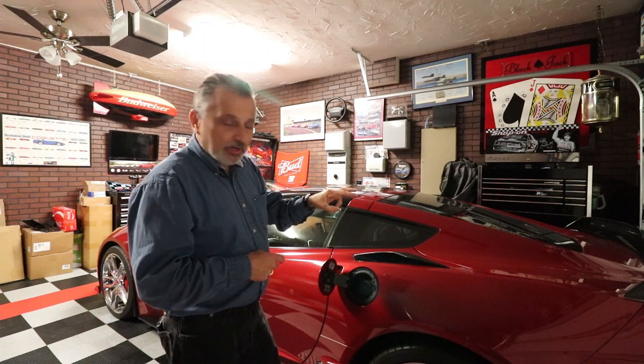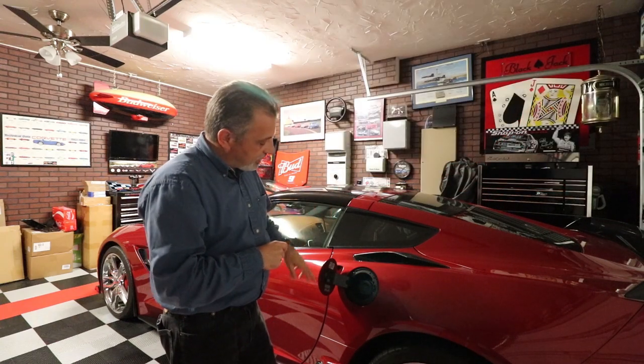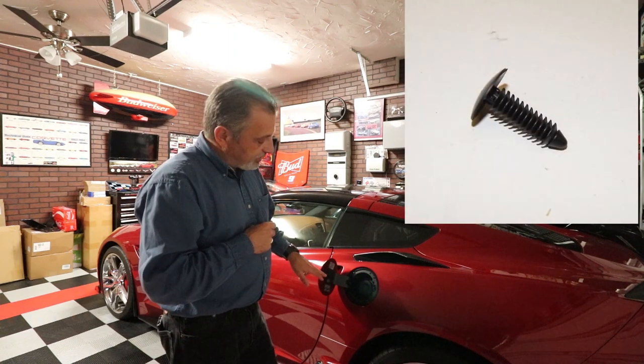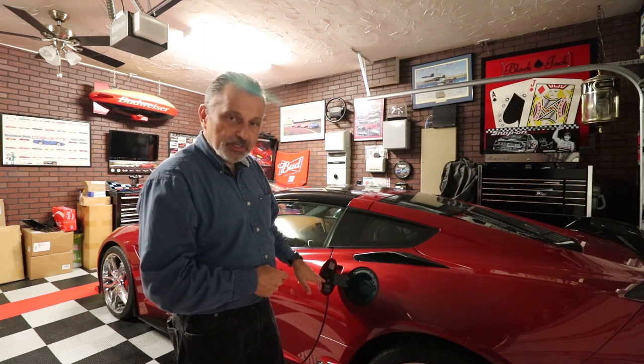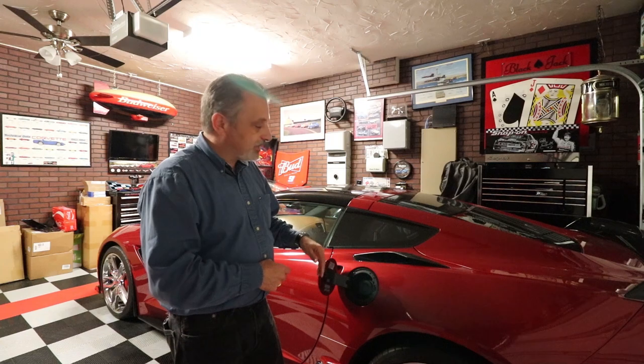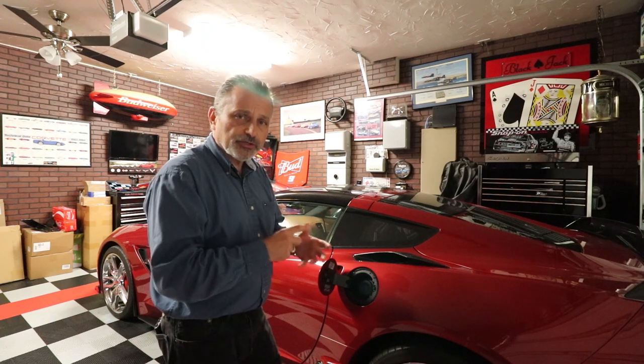The locking pin attached to the motor goes in and locks it. What they came up with is an oversized plug — I'll show you a picture on screen — that just goes into this hole. By doing that, even if the locking pin gets activated it's going to hit the back side of that plug and not lock, so the door can open and close without locking on you. The other thing you can do is go up inside the wheel well and simply unplug the motor, then plug up the hole so the locking pin doesn't engage. That would be the cheapest way of going about fixing it.